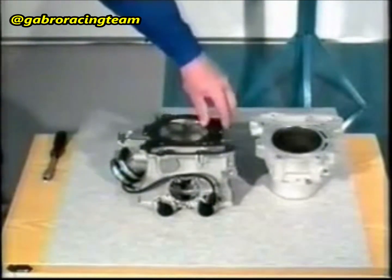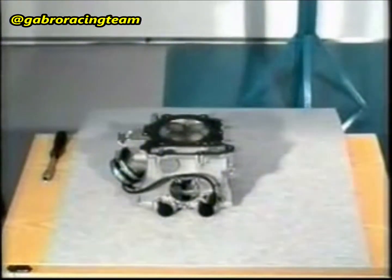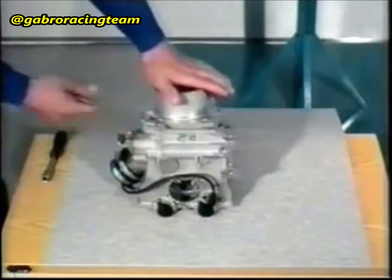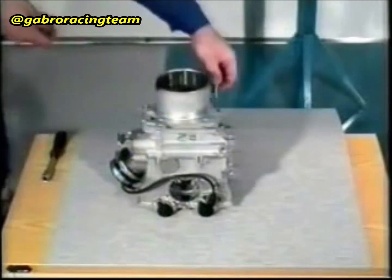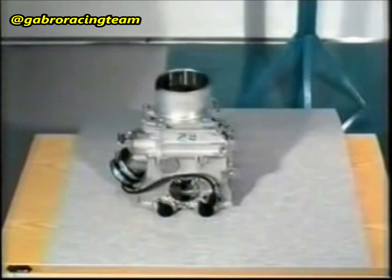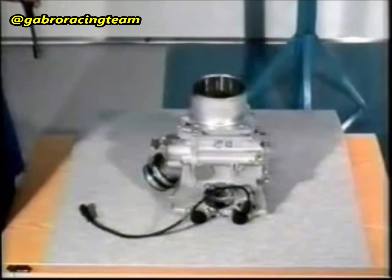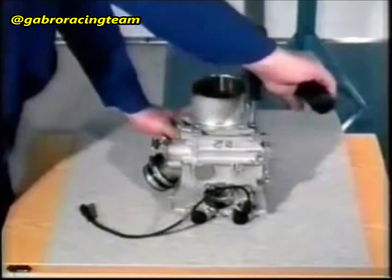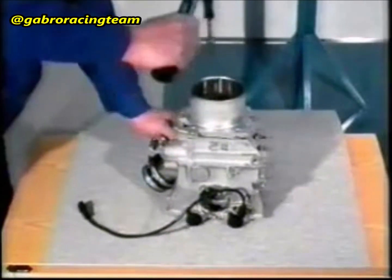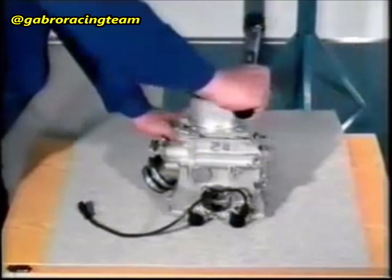Fit the head of cylinder 2 onto cylinder 2. Check that the 2 pins have been assembled. Assemble a new gasket for the head. Assemble the cylinder and fasten it with 4 shouldered hexagon nuts. Attention! The bolt on the induction side is longer. Tighten crossways. The tightening torque is 13 Newton-meter.